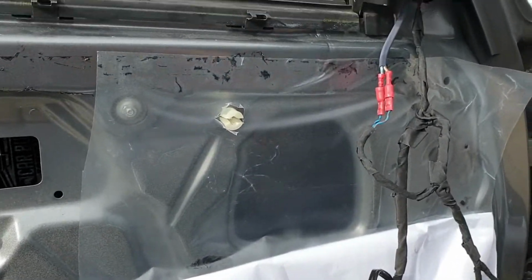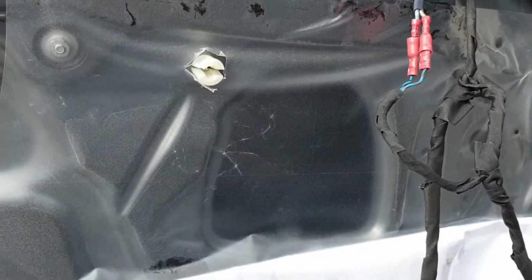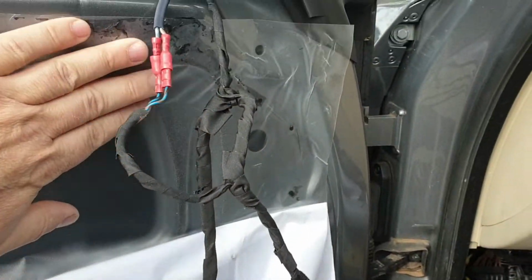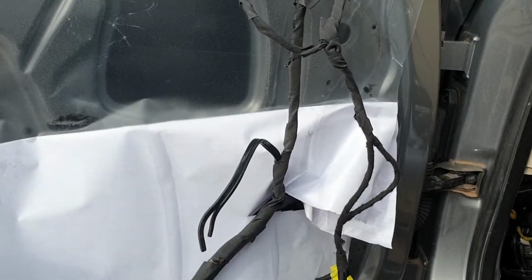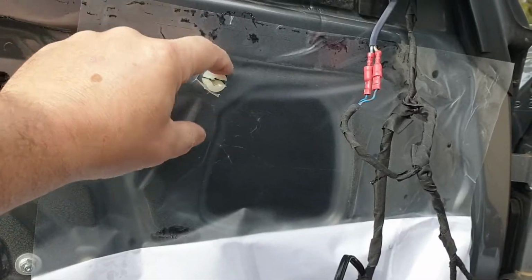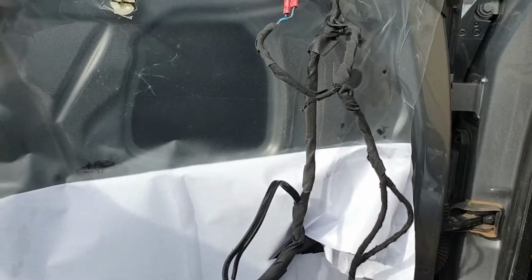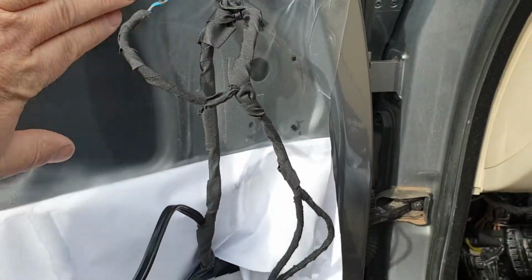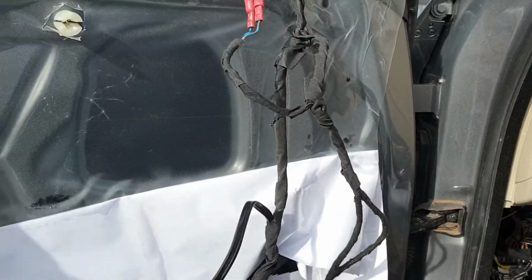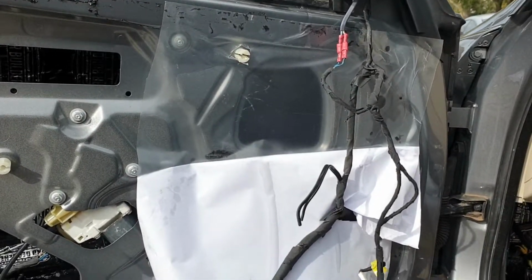Just a couple of tips. What I tend to do is attach it along one edge that I'm working on, and then slowly roll the backing paper down and apply the film as I'm unrolling. Where there are really big items that protrude and sort of kink up the film, try to cut those out so they don't interfere, because the closer you can get the film down, the better you'll be able to see and mark things out, and the more accurate the final sheet will be.